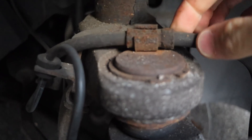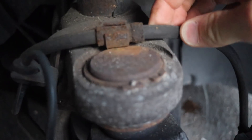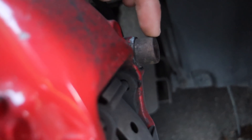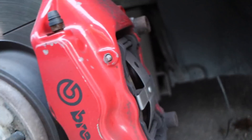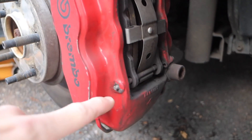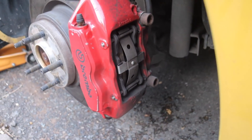When we fitted the lowering springs we cut a bracket that normally sits on here - if you're a Megane owner you'll know this normally has a bracket but it's just flapping about. Things we need to change: we need smaller bolts here because with 17-inch wheels you might struggle to fit them as these stick out so much. Hopefully get these bad boys off. I'm guessing it's easy as - get something, push this pin out, retainer comes out, pad should come out. I think it's literally as easy as that.